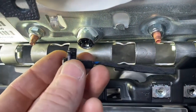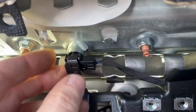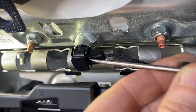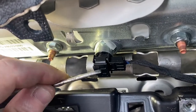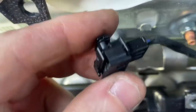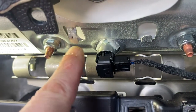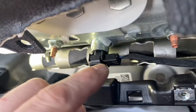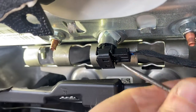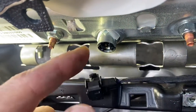To remove the airbag clip, it's pretty tricky — when it's on there you can't see how to get it off. What I did is use a small screwdriver and went in from this side. This part here clips forward, creating a gap. When locked, you push it towards the airbag and it clips into place. To release it, you go in that way, the clip moves forward, and then you can pull it out of the airbag.